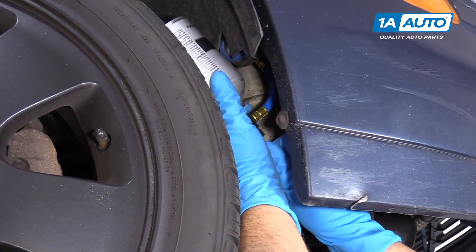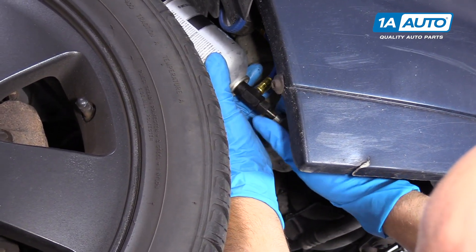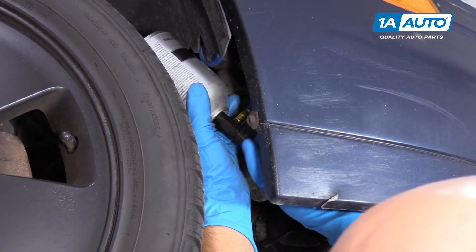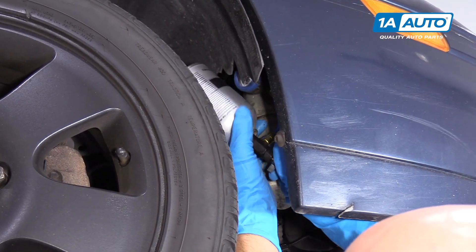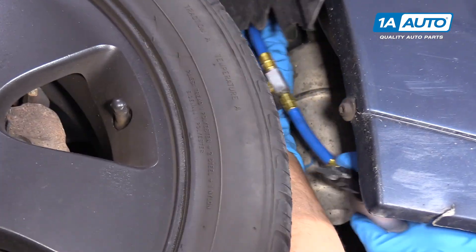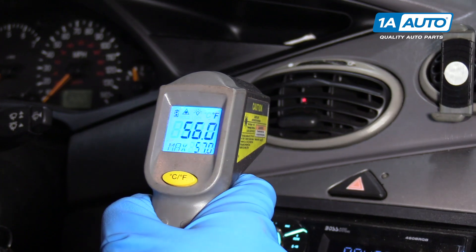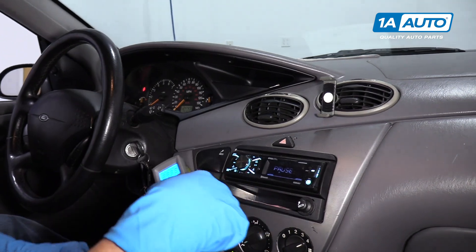What I'm going to do at this point is close this valve. That's going to shut the refrigerant off over here, and then I can disconnect the connector. Our AC system's all filled, so I'm going to check what's coming out of the air ducts — you're at about 55-56 degrees Fahrenheit, which is good. It's nice and cool on a hot day like today.